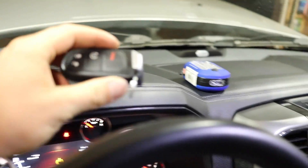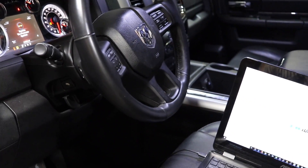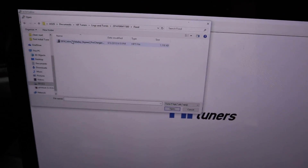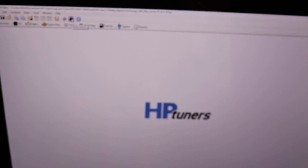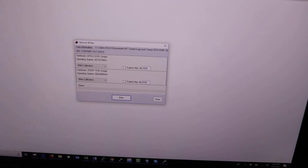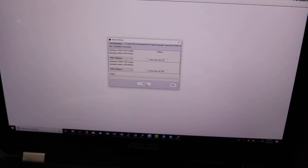Just to be safe with my keyless, I'm going to put it on the dash so it doesn't freak out. We're going to leave the door open because apparently there's some weird stuff when you cycle the key. One guy said he was having issues and when he left his door open - even though it's going to make an annoying chiming noise - some of his issues were resolved. So I have HP Tuners open, this is the file Jay just sent me. You open it by hitting the file icon, select your tune, then click the chip icon with the little red arrow to write the tune to the vehicle.